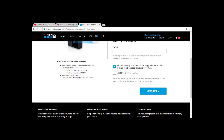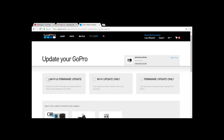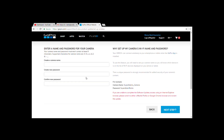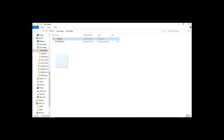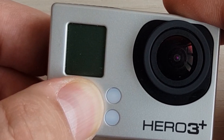But there is a solution. If you had the same problem, follow these steps. Go back to the website and instead of choosing Wi-Fi update only, choose Wi-Fi and firmware update, then press next step. Fill in the form and download the update file. Copy and paste the unzipped update folder to your SD card, place the SD card back in the camera and start it.